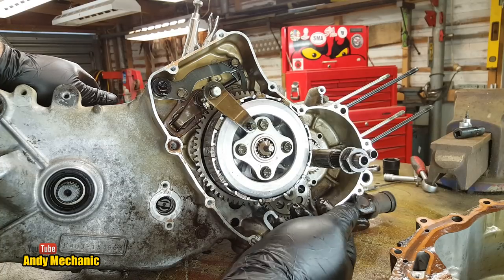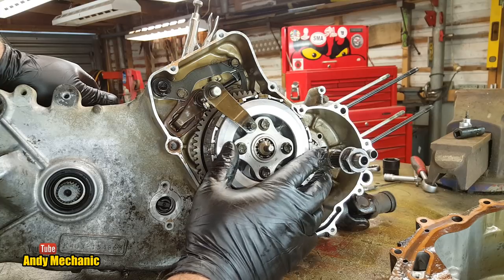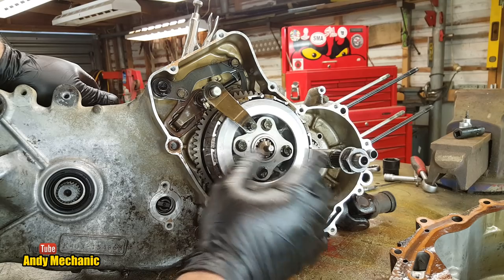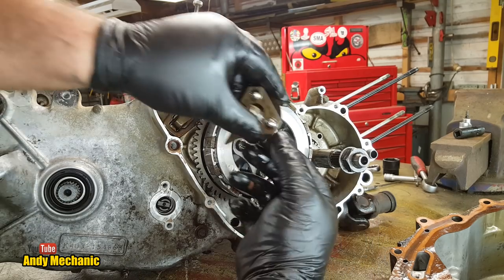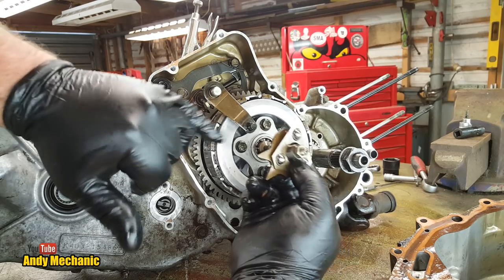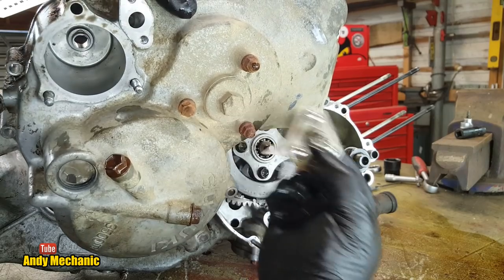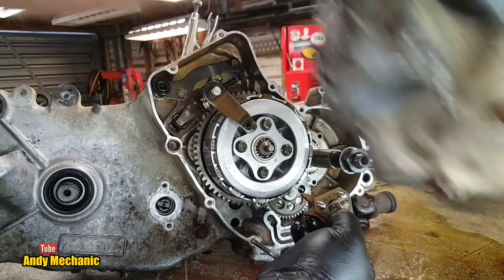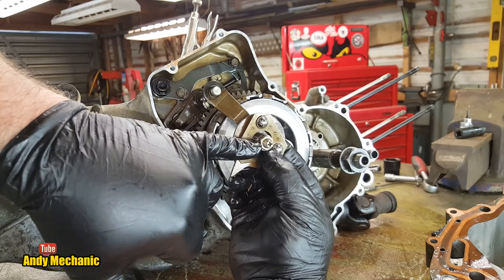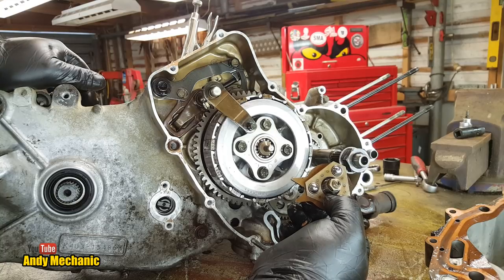Pretty simple. And the first time I came across this was when I was about 13 years old on a Honda C50 moped. It had a very, very similar setup. The adjustment to get this bit working just right, because don't forget these plates will wear over time, is you can remove that little cover there, look, on the outside, a bit like a tappet cover. Remove that, and you can get access to this adjuster, and you can easily adjust it. Very cool, and a super reliable system.